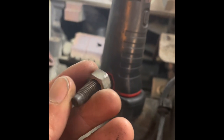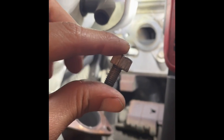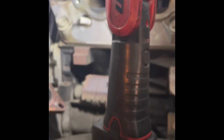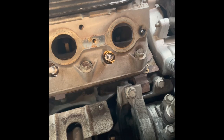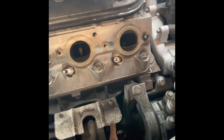If you have this problem, just weld the nut to the broken stud and you're done, instead of trying to tap it and extract it. This is much quicker. Like I said, you can only do it with an aluminum head — if it's a metal head, you'd have to extract it. But with an aluminum head it'll be fine. Now I've got to do the next one. Some cars it's a little tougher to access, but we have the whole wheel well open here so we're good.